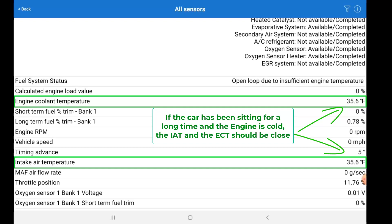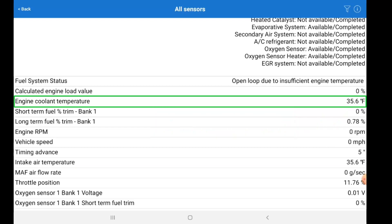Usually if you're checking this in the afternoon, the air temperature is rising faster than a car that's just sitting there — that coolant is going to take a little bit longer to warm up to ambient temperature, and vice versa. If you're checking this late at night, the temperature might be going down and your air temperature might be lower than your coolant temperature at that time. And obviously, if you've been driving your car, your engine coolant temperature is going to be warmer. The first thing we want to verify is: is this engine coolant temperature showing a value close to what we'd expect given the ambient conditions?